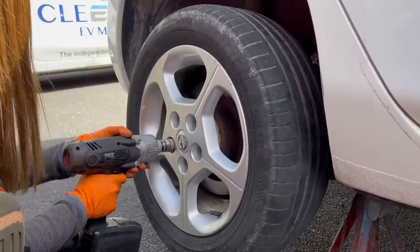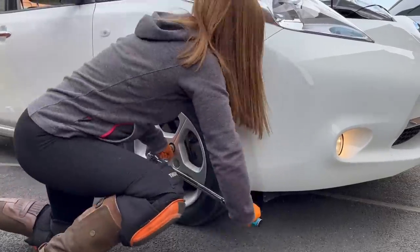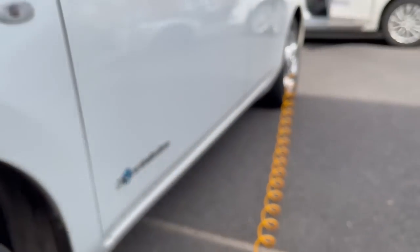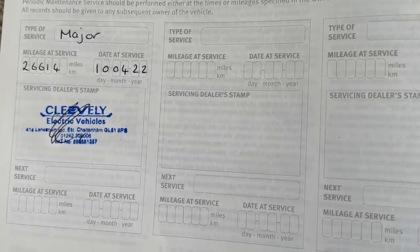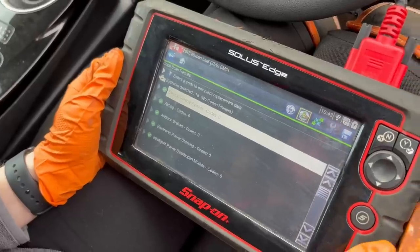We carry out exactly the same process for the other side as well. With all the brakes stripped, cleaned and lubricated and the wheels back on, I can torque them up to the manufacturer's specifications. Unlike the manufacturer's recommendations, I prefer to run the tyre pressure at 40 psi — I seem to get better efficiency from the car and it has no effect on the tyre wear overall. Just a quick stamp in the service book for a major service, and we're plugging in LeafSpy and our diagnostic machine to check for any DTCs. That's it all completed — no DTCs, and the Nissan Leaf has a full bill of health.